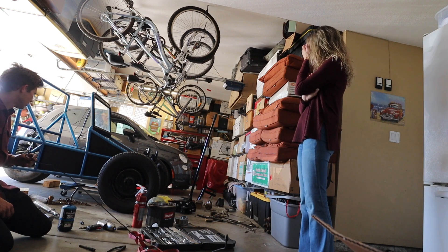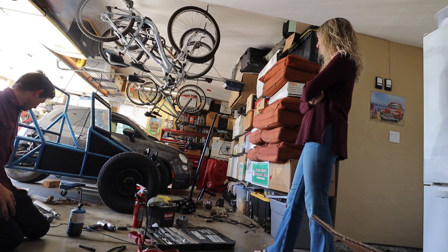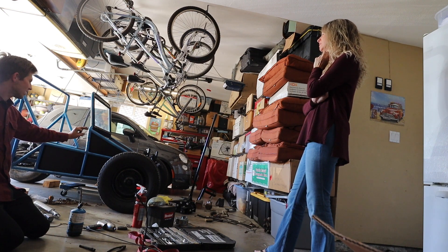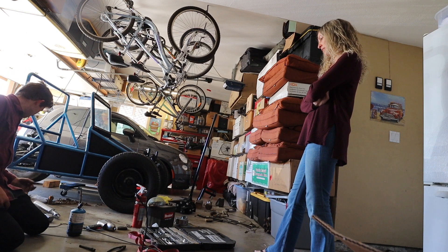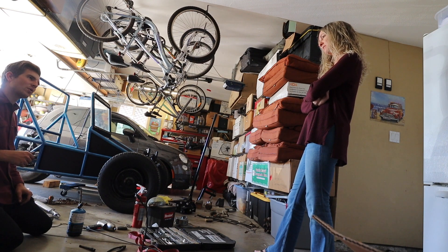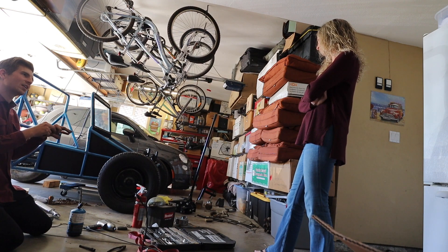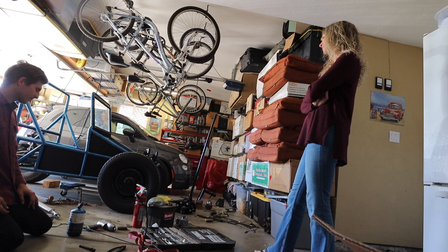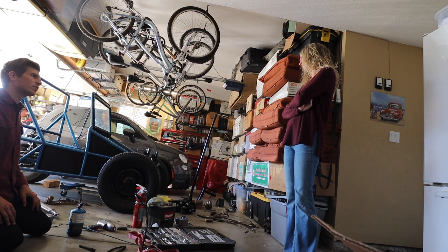Looks more like a car! How were you able to get the suspension on that bolt after it stripped? I had to tap it. Tapping means re-threading the bolt hole — picture a nut in the frame. When you tap it, you cut the threads into it. You get a tapping kit, put it in — it's basically a screw with four grooves meant for cutting. You put some cutting oil on it and go one forward, two back repeatedly until all the material shaping off goes into the grooves. Then you re-thread it three or four times with the tap to make sure all the threads are clean.